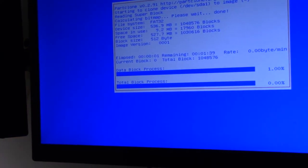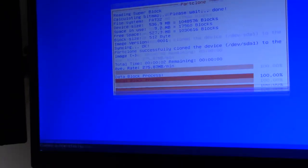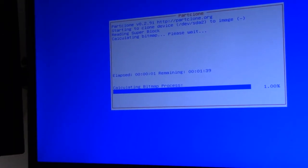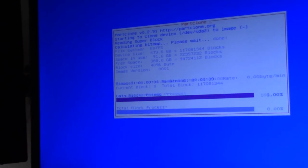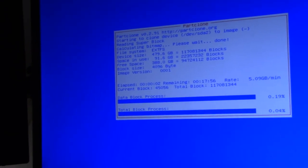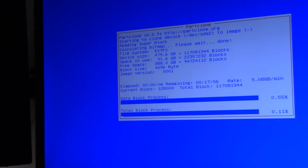The backup is running, and with Clonezilla, you can expect this to take in the region of, give or take, 15 minutes. It might be a little bit slower when you're doing this over SSH as opposed to doing it directly within the machine. I have just done one. I verified on DSM that it created, so I can confirm to you that this process works and creates a disk image directly from your desktop onto your NAS on the network.